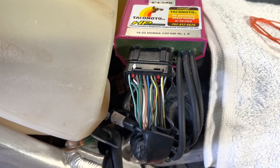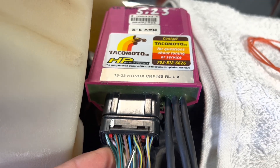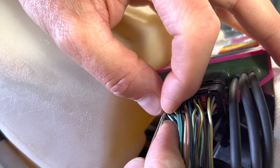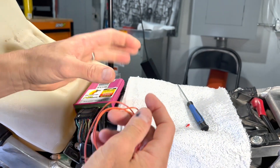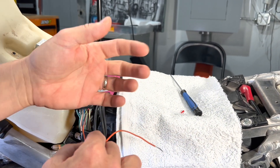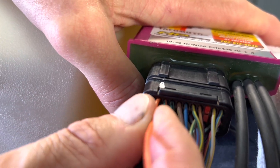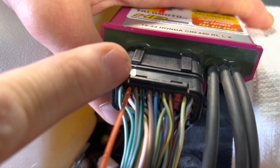First thing you're going to do is remove this little pin plug. Notice the orientation — this is the bottom of your ECU. This is the top row of wires. There is a plug on the right, and the one on the left comes out. Be careful with this and save it — it needs to go back in later. Now, take a two-foot piece of 18-gauge stranded wire, stripped about eight millimeters on each side and twisted. Insert that into the cavity you just opened up until it stops — at that point it's in contact with the pins of the ECU.